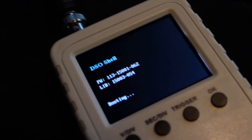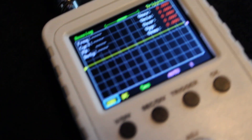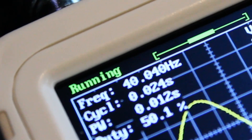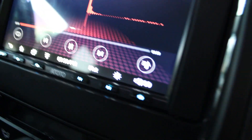Make sure you turn the gain all the way down and open up your low pass filter and subsonic filter all the way to the left. Turn this off. Turn on your oscilloscope. Check that you're getting a 40 Hertz tone — right there, 40. Make sure the volume is turned up all the way on your head unit and that your bass control is turned up all the way as well if you have one.